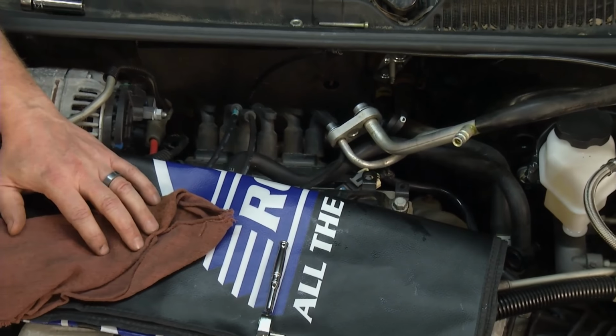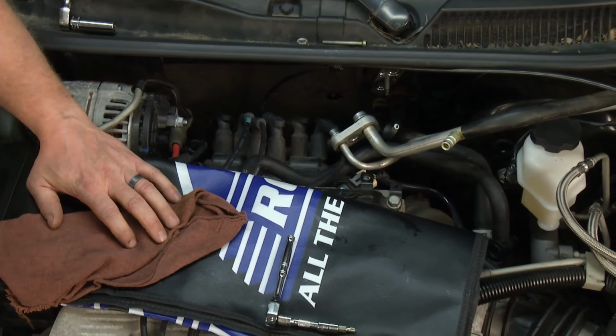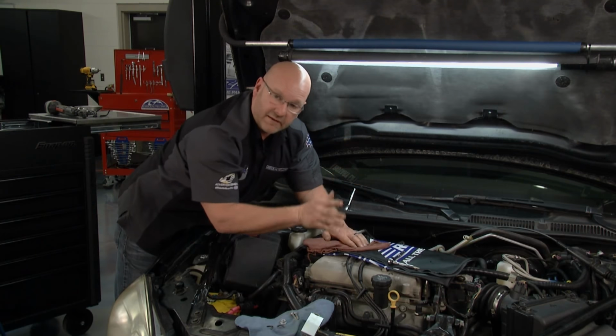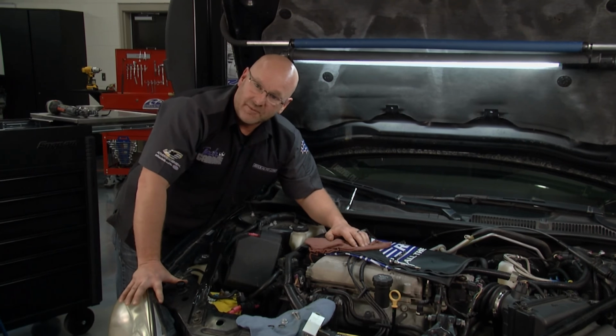Our Arctic Pro is going to do that for us back to the low side port. But you could do that vacuuming with a vacuum pump. You could draw that out. Again, 30 to 45 minutes, check the spec and see what it wants to be. We'll get that done. We'll top it off with refrigerant, and John will have nothing to complain about anymore.